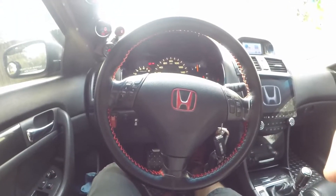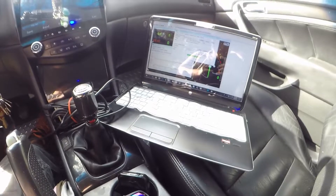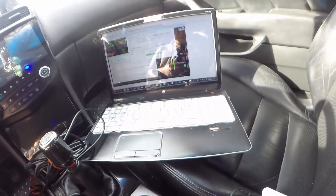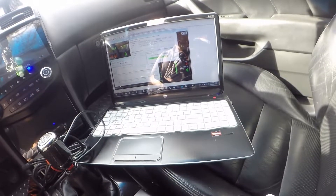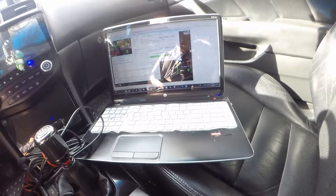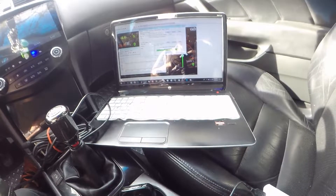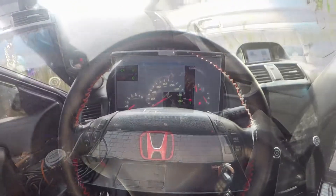Maybe I need to pull fuel out or add fuel for the cranking. Let me get my computer and see if I can figure out what's going on. I'm tuning now, getting closer and closer. I have to keep increasing the cranking fuel because obviously the pump is different in flow, so it's going to affect the tune. So all the tuning I just did is out the window - I've got to retune for this fuel pump. I'm slowly adding fuel to the cranking fuel and it seems to be working. I'm getting it to run for about half a second now, where before it would just blip on and shut right off. Getting closer.